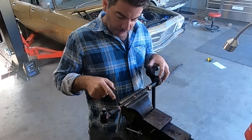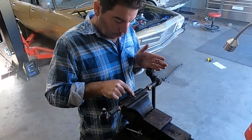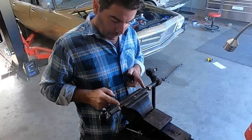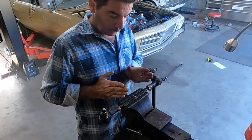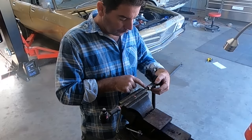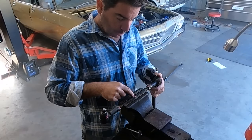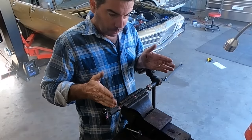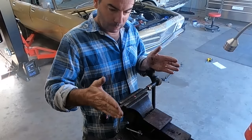Well, when you go to get a wheel alignment, to change the length of this distance, you back these nuts off and you're winding this rod. If it was right thread, all it would do is shift. It wouldn't push both out. That one to go out, this one to come in. So being left thread on one side, right thread on the other side, when you undo or twist that, it pushes them both apart or both together, which is connected to your steering arm. So it's going to bring your steering arm in or out.